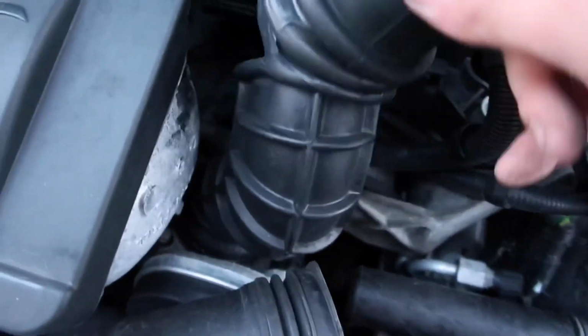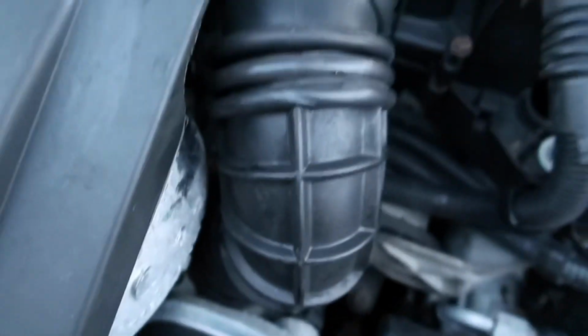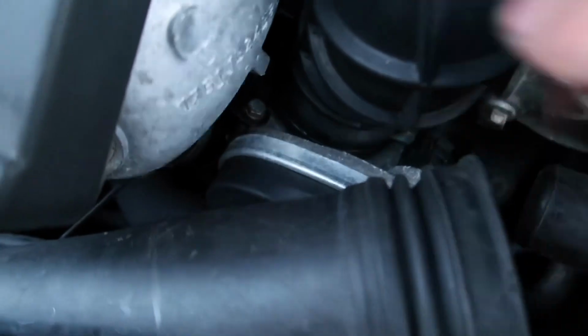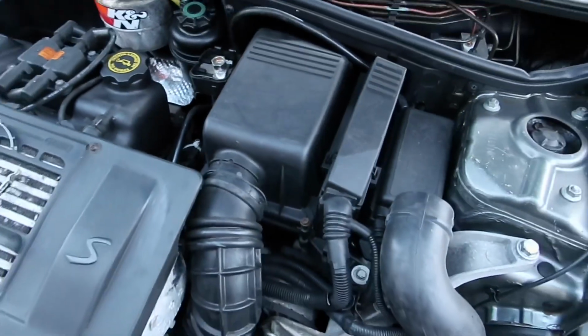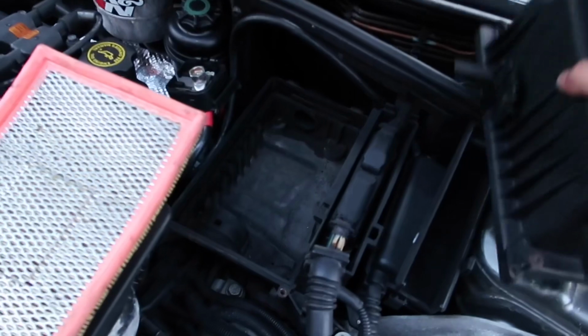Probably best to remove this pipe first, as I was sort of pulling at it and I found a big split in below, so it was always good changing this, as that's something you wouldn't see, you wouldn't know it's split. But it's split in there. So yeah, just the other clip here to pull this pipe off and just pop off the airbox. It's loose now anyway, so I'll do that now. Okay, so that's the airbox top off, which we're not going to need again.